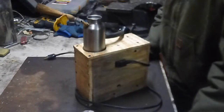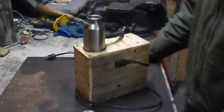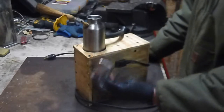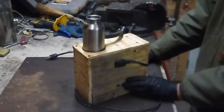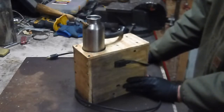In brief, what we have here is a smoke machine that I built to track down some intake leaks on my BMW. I'm using 22 gauge nichrome wire, baby oil for the smoke. For a power source, I'm using a microwave transformer. I rewound it myself down to about 5 volts. It draws about 14 amps.